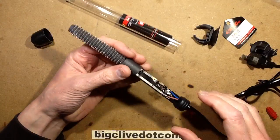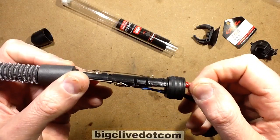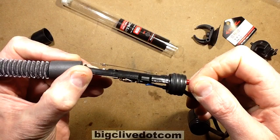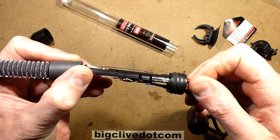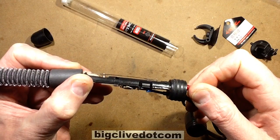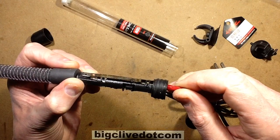It's got the heating element and the bimetallic strip thermostat. I'll show you this operating — if I turn the little knob here, it's got a magnet to make sure it opens and closes decisively. It doesn't take much turning of the knob to actually make it click in and out.